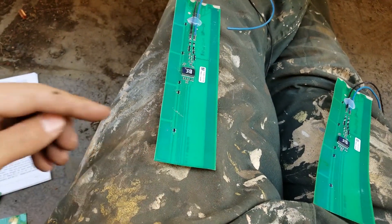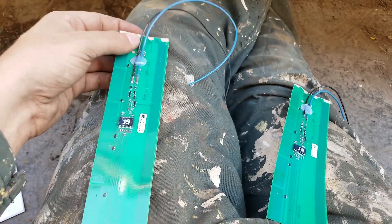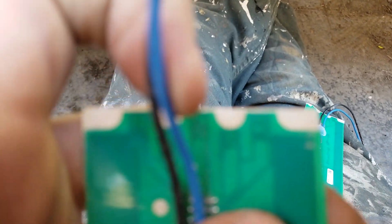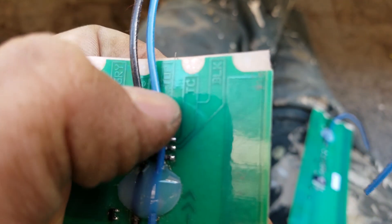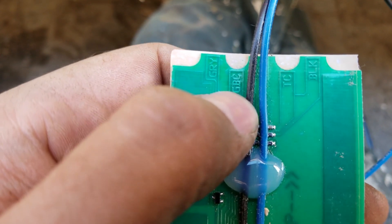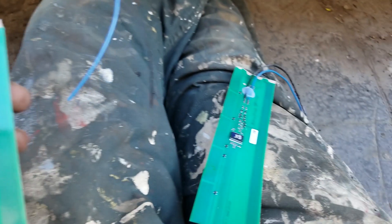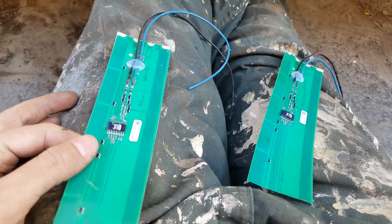These two have already been cut to size — they were originally longer. You cut them down in between the gaps in the sensors to whatever size you need. Since I'm doing two for each tank, I have a top and a bottom one. To tell which side is the top, we have these tabs here. This tab is cut for black water tank. I don't remember what TC is — I think that's if you make a mistake. Top is if it's the top sender on a two-sender system. That's the gray tank tab, and I think this one's also for if you make a mistake. One of these will get the top tab cut, the other stays as-is because it's fresh water — you don't cut any tabs for fresh water.